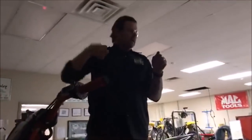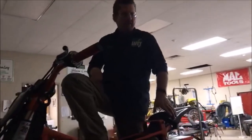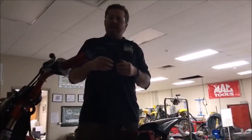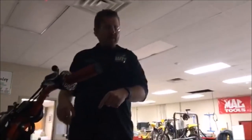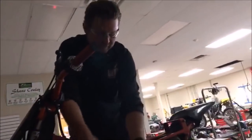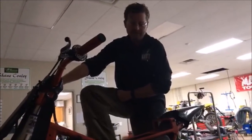Think about something though — that's only us kicking it over. Do you remember what RPM we can kick a vehicle over to? About 600 to 800 RPM, maybe even a little less. But as soon as this thing's running and idling at 1,200 or 1,500 RPM, that's going to increase the intensity of that spark leak. So the bad cap might not even show itself using a tool while kicking — we're actually better off here because this doesn't have a computer to hurt. And being able to see it — whoa, did you see that one? Get down here on this, this is just way too good. That cap is bad; she's leaking pretty good.